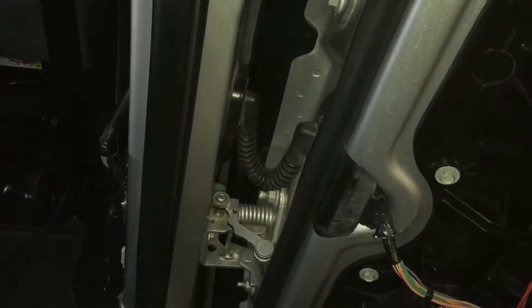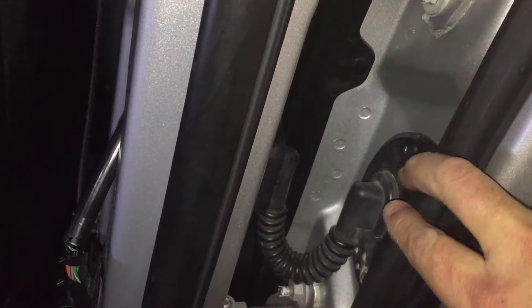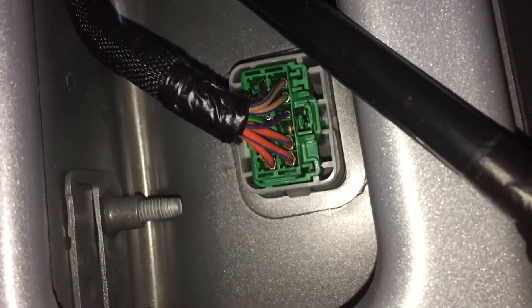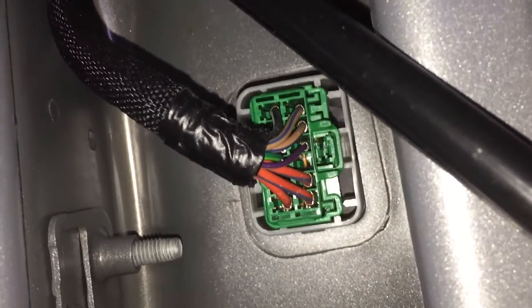The back could actually prove to be more challenging. The boot back here has two screws — looks like Torx 20, no problem there — and it's very similar to the front to pull the boot off, but this boot is a lot smaller. Coming around the other side, after removing the bottom B-pillar, there's not a lot of room to run a 16 gauge cable back here.